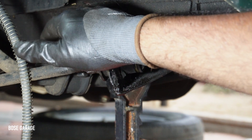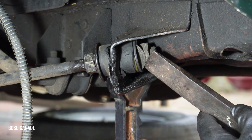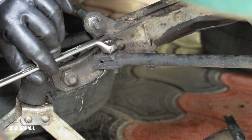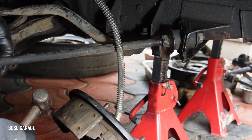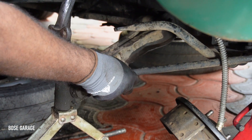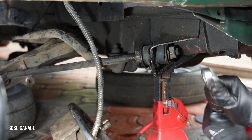Now let us remove the tie rod or tie rod anchor. There are two nuts on either side. As you can see, they have put some metal shim in between — most probably due to excessive wear and tear between the tie rod and the tie rod anchor support. Normally there should not be any excessive clearance because it can create noise when the vehicle is running. If there is excessive clearance, you can get it reconditioned to maintain a minimal gap.